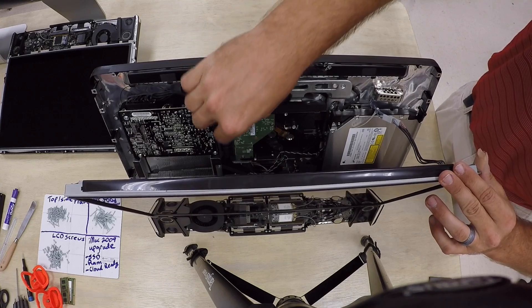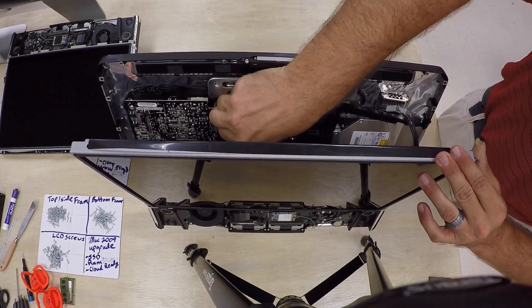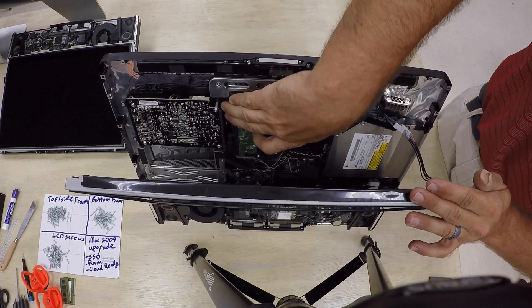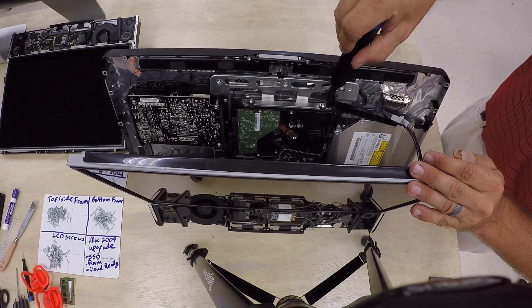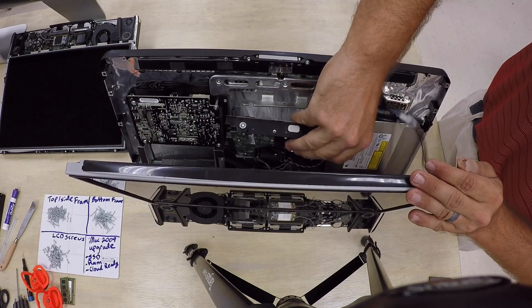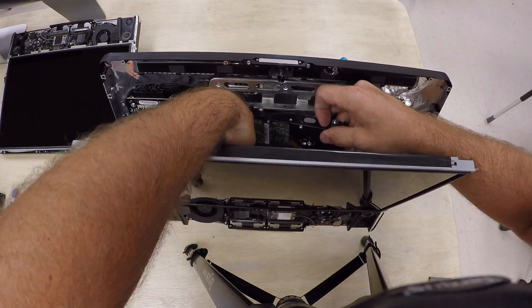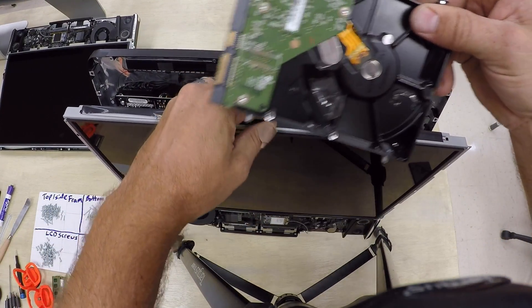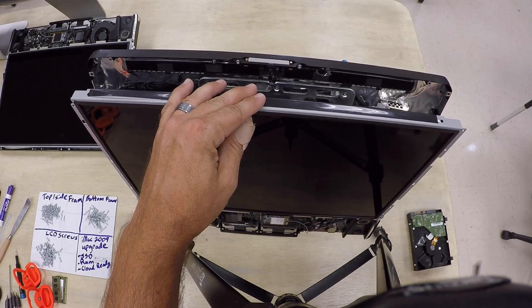Pull on the lever at the top towards you to loosen the hard drive. If it doesn't come out easily, unscrew the two screws on the top with the T10 bit to loosen it further. I recommend putting a glove on your left hand because you can severely scratch your knuckles on the power supply when removing the SATA cables. Lift the hard drive up and pull out the SATA data cable and SATA power cable to remove the mechanical drive. This drive is nine years old and will slow the computer down — it pretty much needs reformatting every other year.